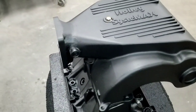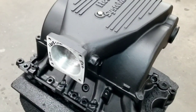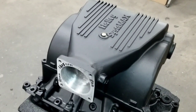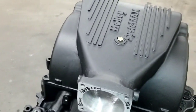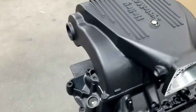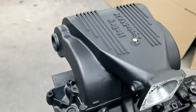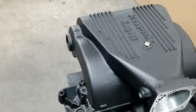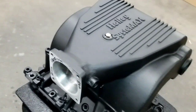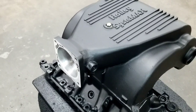This coating is tough like powder coat, but it reflects heat and keeps the part cool. The special thing about this BRD manifold is the fact that the runners are short — short like a Box R. The runners are in the 11-inch long range, and this particular manifold flows well over 340 CFM average per runner, which is plenty. It actually flows more than an out-of-the-box Super Victor.